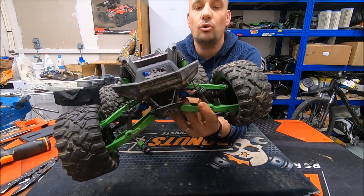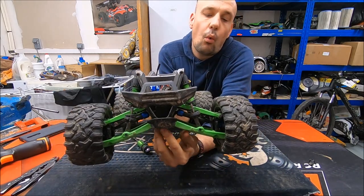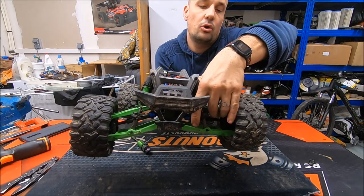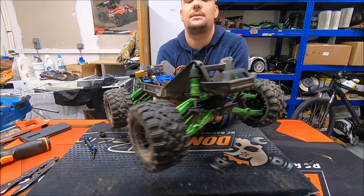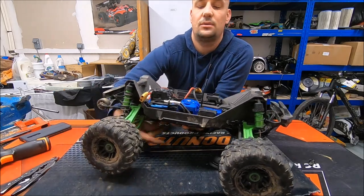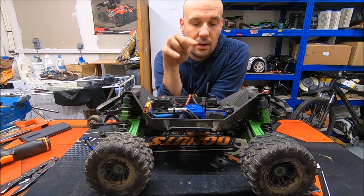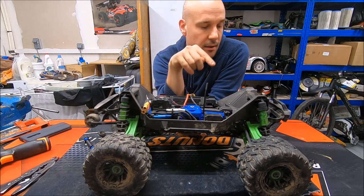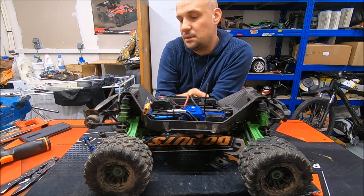At the front I have also made the modifications. You only gain one centimeter of ground clearance, but that's a lot. At the center you can measure on your stock one — I now have nine centimeters high, and at the front under the bulkhead we have seven centimeters.